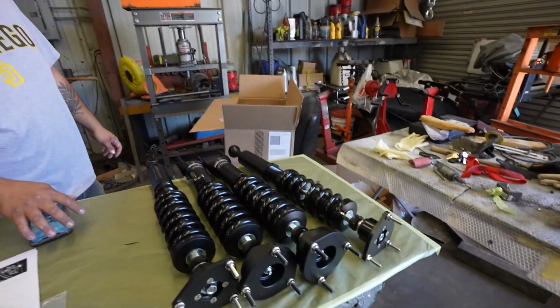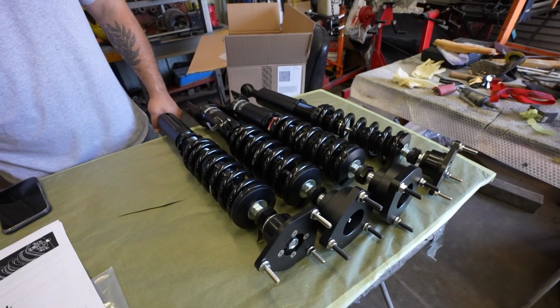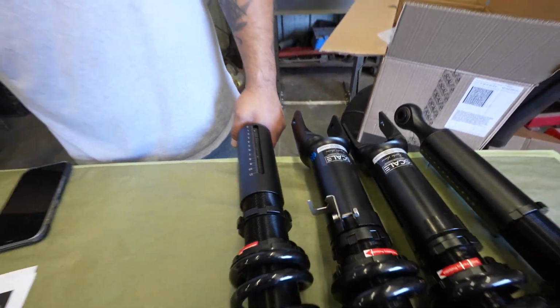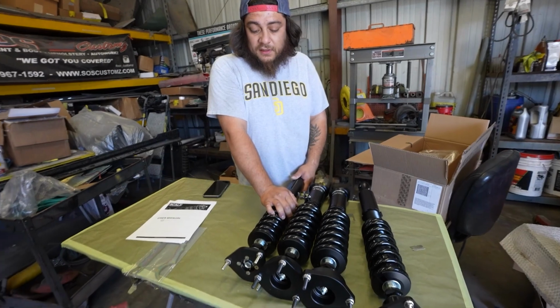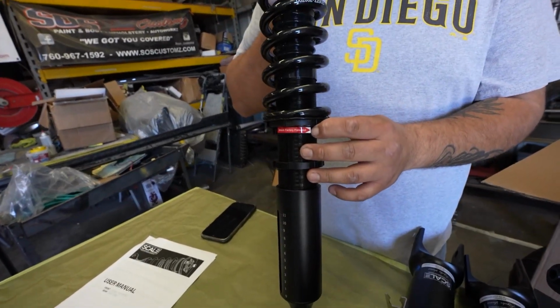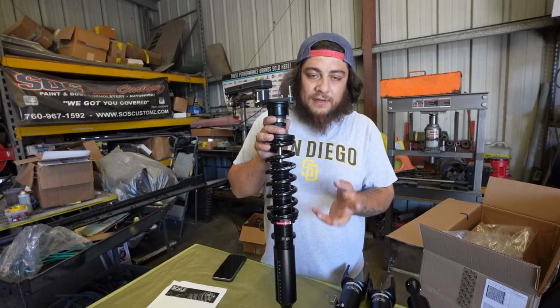Never. Everything's perfect. But what do you think overall, as far as the suspension? How is everything? Well, that's kind of a cool little deal here. Yeah, it's a pretty well-made coilover. One thing that I've noticed, obviously, from the stuff that I've installed, some lower-end brands will leave the preload for you to adjust, and some high-end brands will already preset the preload, so you don't really need to mess with it unless you change it to a desired spec, track, drift, whatever, etc.